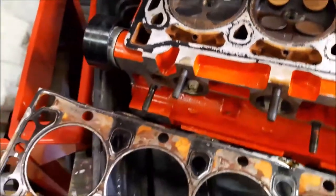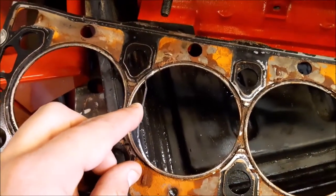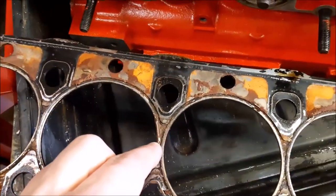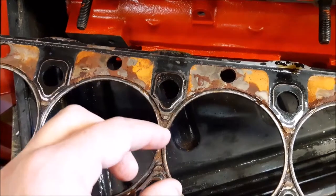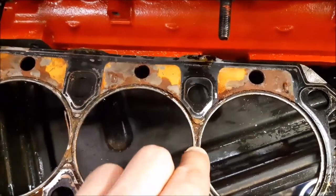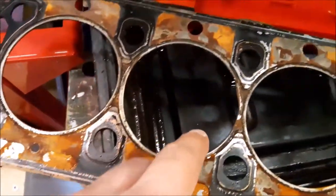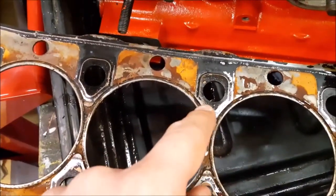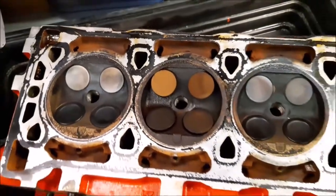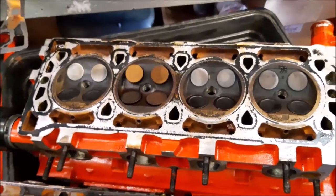I just want to let you look at the gasket again. Although we looked at that, we found not only delaminating this side, but on this side, you can see it's very rusty and it's all coming up here, whereas if we go over to this side, look, even with my fingers rubbing it, that is still very much intact, whereas here it's very rusty and breaking up, here delaminating. So the good thing is there's definitely good signs the head gasket has gone, and that has been our problem.